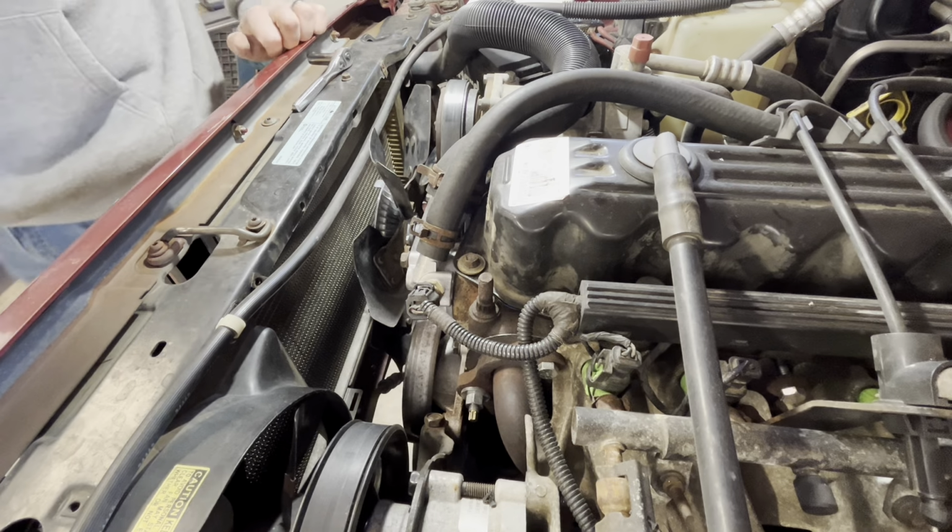There've been a couple issues on this Jeep where it seems like somebody has been into the connectors before. I didn't video it, but I chased a problem. When I first got it, the blower motor would run, but nothing would come out the vents. And I thought it was clogged, but actually it wasn't clogged. At some point, a long time ago, somebody had the connector apart for the blower motor and had the pins reversed. So the blower motor was working, but it was running backwards.